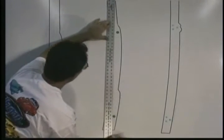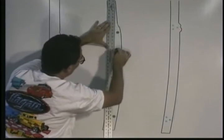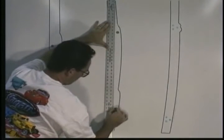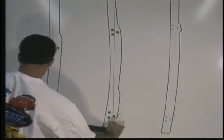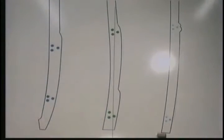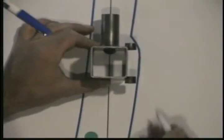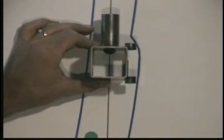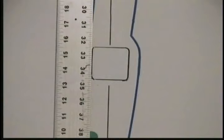Make sure the car is level and mark a plumb line. Select a position for the bottom receiver and keep the receiver square with the plumb line, then mark the position. The straight edge shows our position as parallel to the plumb line.